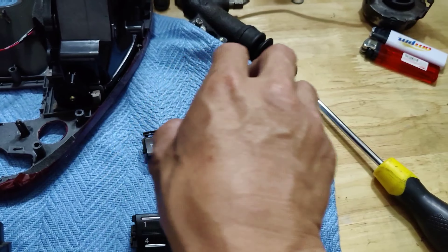I had a blast peeling all this off, little shred by shred — said nobody ever. Now that we got it done, I'm going to go ahead and scuff this down. This is how it looked when I first got the car, so I was like, I'll just attempt to wrap it. After about five months it started bubbling up, so we're going to fix this eyesore. What I did was I cleaned up all the gunk with Goo Gone, just a very little amount, wiped everything down, sanded it down with 320 and then 400, then wiped off all the debris and dust. It is ready for primer.